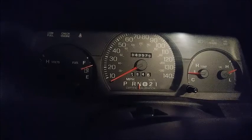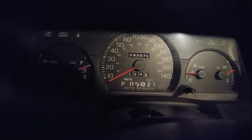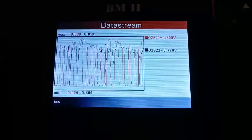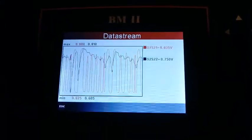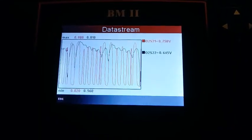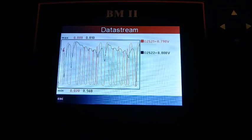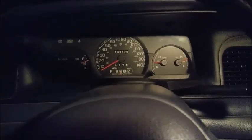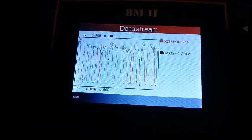For if you change the transmission range sensor and your overdrive light still flashes when it's in park, your code still comes back on. But we were more interested in making sure our check engine light doesn't come on for a cat problem, because we need everything ready before we get it inspected, and we don't want a cat code coming on, because we can avoid the transmission code now that we know the pro tip, but you can't really prevent a cat code unless you put that little cheater device on.